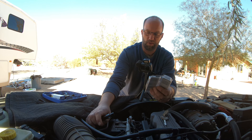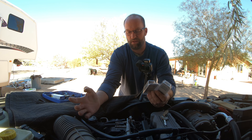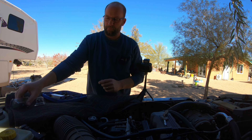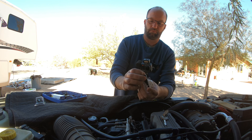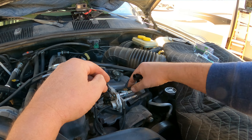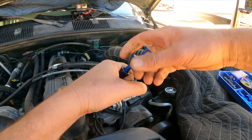I don't want to go making new fuel lines. I wanted to have it OEM. This has made it almost 30 years. I don't know if I'm the first one to change these but I can't imagine I'll have to do it again, but I'm sure that someone else has run into this issue. So to change these, I'll go ahead and take the 3/8 one out and insert the new retainer onto the fuel line. Then I have to get these guts out and into that fitting, and that posed even more challenges. But we know how to get the guts out — let's do that.